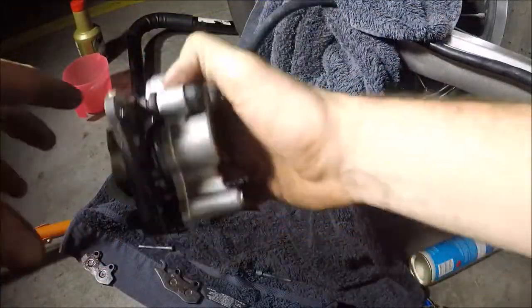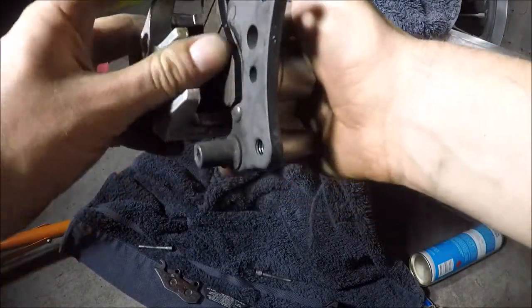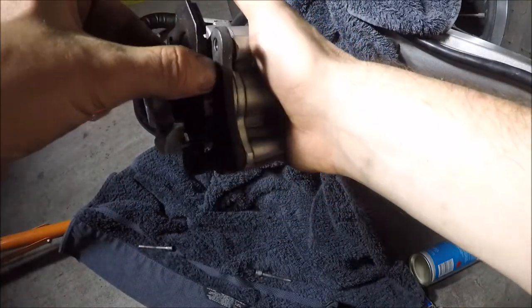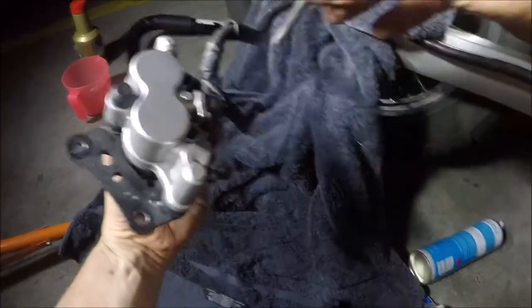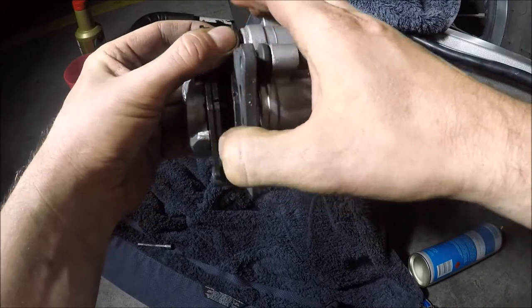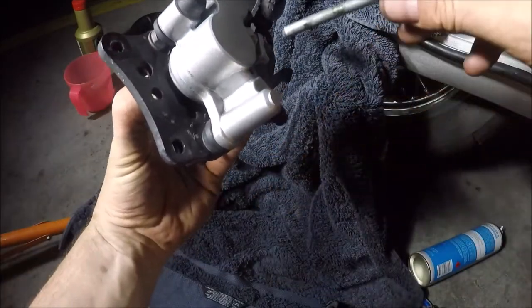Once you're happy with your copper grease, start to put your pads back in. The one without the tabs goes first — get that in nice and tight up against the pistons. Then you have one — rotate all the way around, hold them apart, push down against the spring, and start to work the pin through, making sure you keep the separation. Push it all the way through and then do the other side.